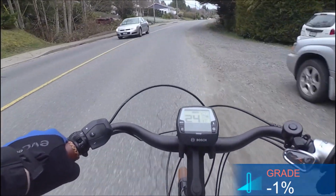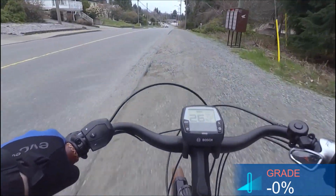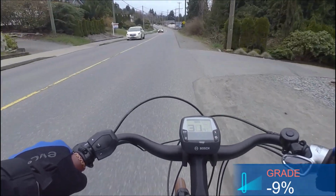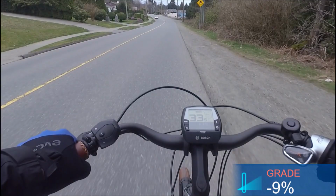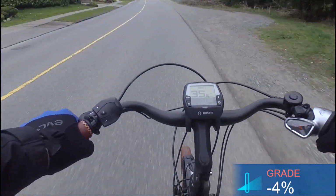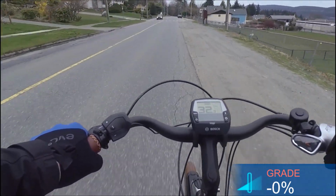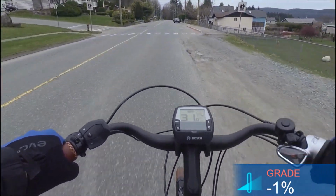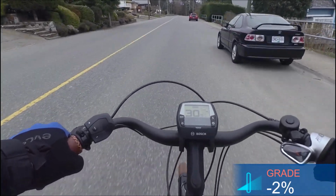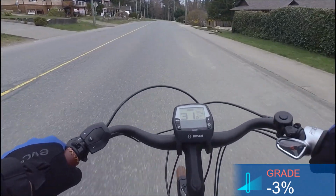All right, try some bumpy road surfaces. Here's a little bit of gravel, some potholes, and oh, the front suspension's handling it really well. And I really like the suspension seat post. And the saddle itself is really comfortable. I think these Schwalbe balloon tires also help smooth out the ride. They've got a lot of air volume in them. And you can get the pressure down quite low, anywhere from 35 to 70 PSI. Probably running a little over 40 right now.